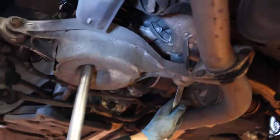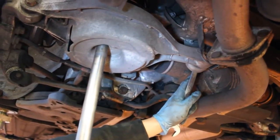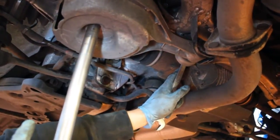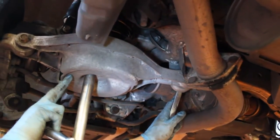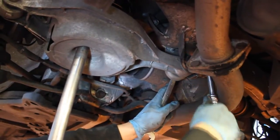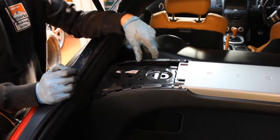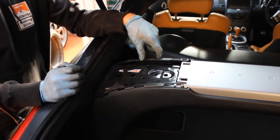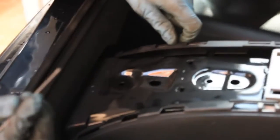When using stock suspension, you'd normally need to torque the bolt with the car either on a 4-post ramp or on the ground. With the HSDs and limited droop travel, you can do this by jacking the hub up to your approximate ride height and then torquing the inner bolt. Due to the design of the rear suspension, to adjust the damping without having to remove the damper, you can access it through this trim clip hole using a 2mm Allen key.